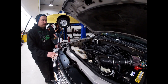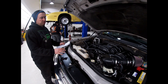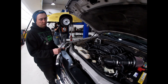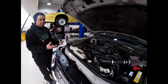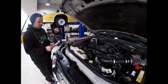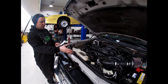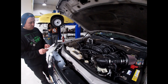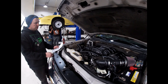Luckily, we've had the benefit of doing a lot of Edelbrock superchargers here at Hi-Tech Motorsport, so we had a really good idea of what's needed to get the kit installed and operating. Looking at a vehicle that doesn't have a dedicated kit, we're able to address the small issues of mounting a reservoir, mounting a water pump, mounting a heat exchanger up front, and getting all of that routed and looking right. When they make a kit for a specific vehicle, Edelbrock lays all that out in the instructions. On the custom side, we had to do a few extra things: removal of the intake manifold, taking the front bumper cover off, the mechanical fan, the front bumper itself, the battery — all that comes out pretty easy. Installing the supercharger itself follows the Mustang instructions since it's the same 4.6-liter 3-valve V8 — no change there.